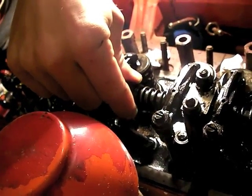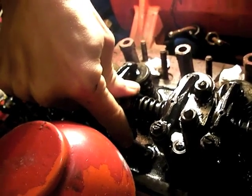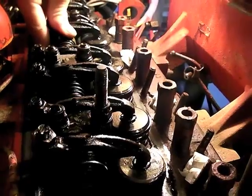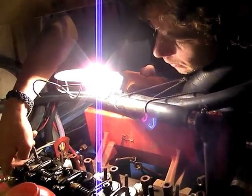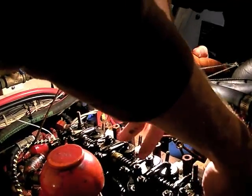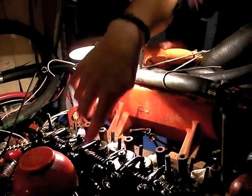So when you put it back together, that's the most critical thing — that's what you can mess up the worst. You can rotate this shaft, and when you tighten it down, I think it grabs it — that's how it works. So it's possible when the shaft is off for it to get rotated so that the feed doesn't line up, and then when you bolt it back together, it plugs this up. I don't remember exactly the configuration on here, but it's something to look at carefully.